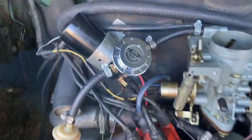At least this will eliminate one of the known issues. I truly believe that fuel is pushing past the float and needle. And then I will continue my search for fittings that actually fit. I need to contact Holley direct. The old one does 2.8 pounds and this will be 2.5. So this could end up working, we'll see. But let's go ahead and get it hooked up. We'll start Myrna and we'll see what happens.